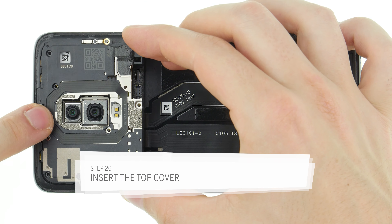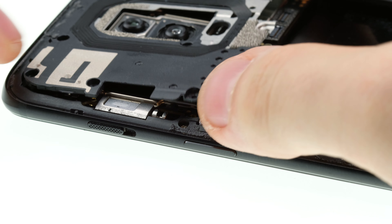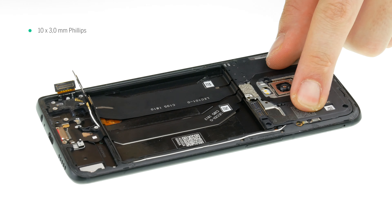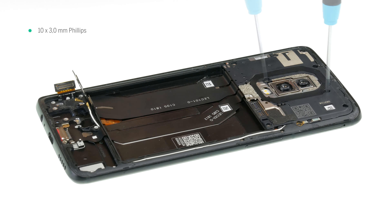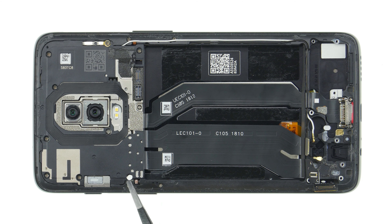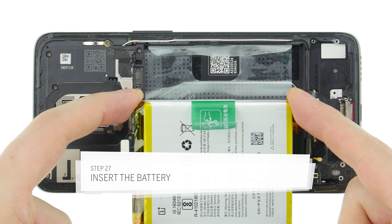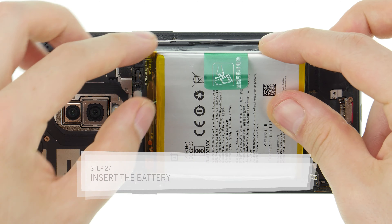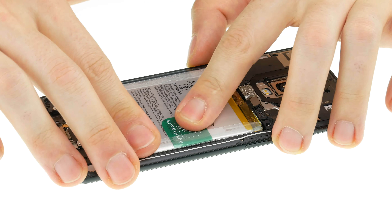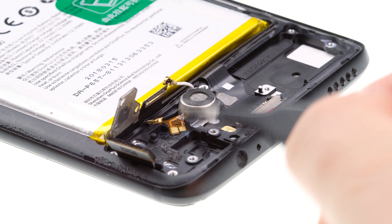The top cover is hooked into the frame on several sides. Attach the cover to the top edge and press it in place. Make sure that the noses on the sides are in the frame and do not look beyond it. Screw the cover with the Phillips screws. Stick the transparent film back in before you put the battery in the device. This makes it easier to remove the battery in the future. Put the battery in its place and make sure that it has some space on all sides and is not pressed against the frame or other components. The battery contact should be directly above its slot on the mainboard. Stick the film back onto the battery on both sides. Place the vibration motor in its opening. Make sure that the contacts are in the correct position. Press the vibration motor and contacts to make them stick.